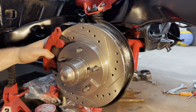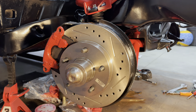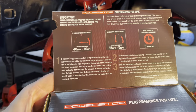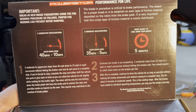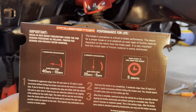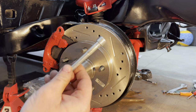Cool, so there's just enough clearance. It'll still drag some, but new pads will always drag until you break them in. Power Stop has a very specific break-in procedure on their box: five aggressive stops from 40 to 10 miles per hour, then five stops from 35 to 5, then you drive around for five minutes and let everything cool off — then it should be broken in.